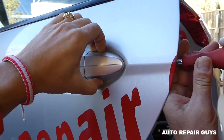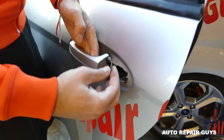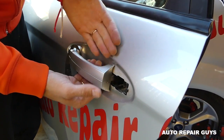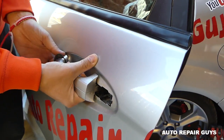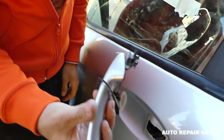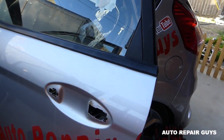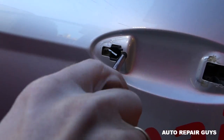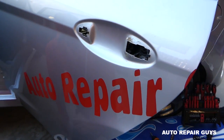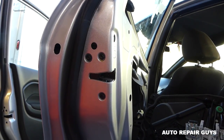Keep an eye on that cap as it comes loose. Next, open it a little bit to get that seal on the door handle so you don't break it — those are usually easy to break. Open it just a little bit and slide it towards the back to come out, then remove the door handle out of the way. There's one more screw here with T20 — remove that screw. On this side we need a T30.